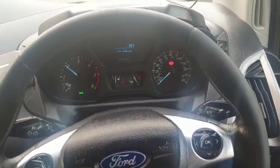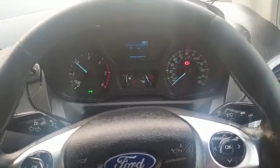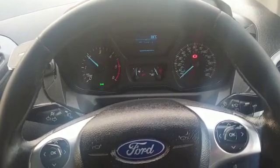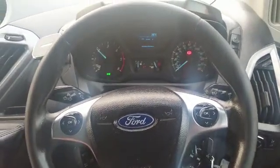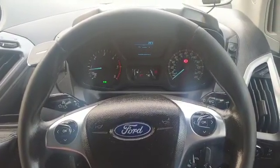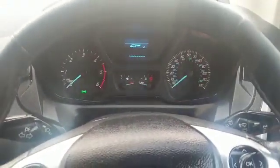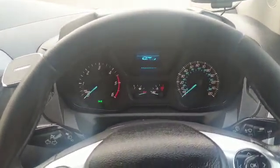This one's set to about 20 seconds. Hopefully it'll start beeping any second — that's it. It's beeping at us now to tell us that it's about to be shut down, warning us. We could now enter the pin code on the steering wheel and it would disarm it. It's going to get faster and then it'll cut the engine out. Just killed it — so it brings it to a controlled stop. It slows you down and just slowly shuts it down as if you're running out of fuel, so it doesn't just turn it off. It also controls it at low speed. So it does it very controlled and very safe.